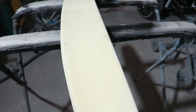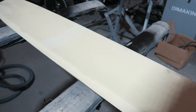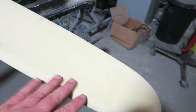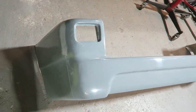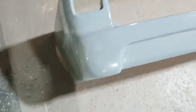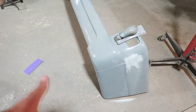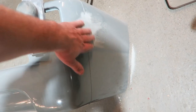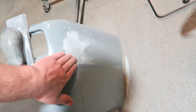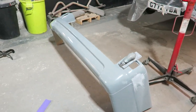Here's a T4 roof spoiler. The eventual plan will be to blend this into the tailgate and use it when I do the carbon fibre mould of the whole rear tailgate — I'll obviously need to make sure everything's plug shaped so it can pop off. Just doing some prep on the rear bumper now, taking the mould lines out. This is an Audiosport rear bumper — much deeper than a standard one which is going to be far better for the under tray. All I'm doing with the mould lines is getting some 320 on a pad and just taking it off so that the mould line's gone, nice and smooth all the way down, then 320 the whole thing ready for primer.